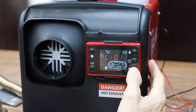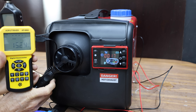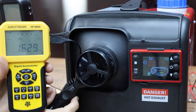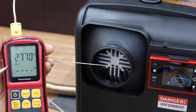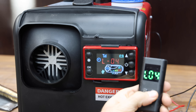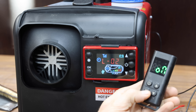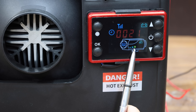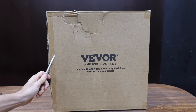Let's lower the heat setting down to the lowest level. The noise level from the fan is very close to 60 decibels, which is pretty quiet, and the air outlet airspeed is still around 16 miles per hour. On low heat, the air outlet temperature is pretty hot at around 277 degrees Fahrenheit. The remote control is pretty handy — the up and down arrows adjust the heat setting and it can also be used to power down the unit. The Civil took just over four minutes to run its cool-down cycle and then power off.